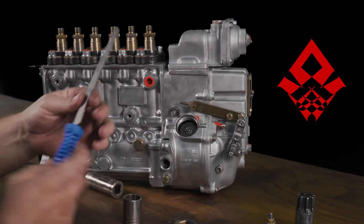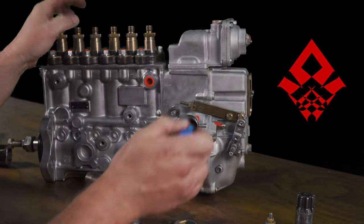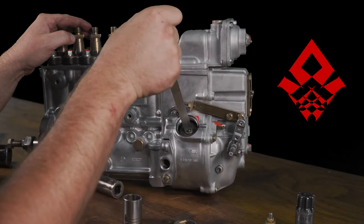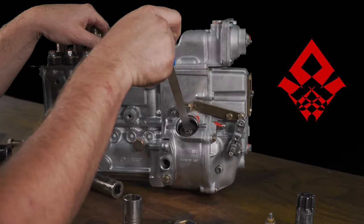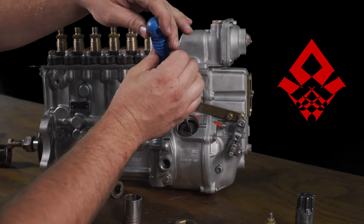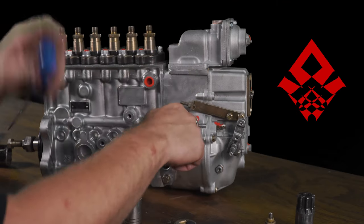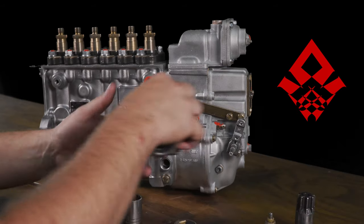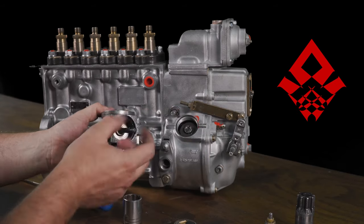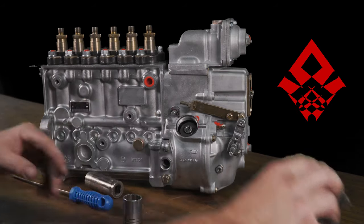Now the governor springs are lined up. Take your Power-Driven Diesel governor spring tool — it's just a little nut with two slots. Put it in there and back it off. I like to count the clicks when you're pulling it out; usually there are about four hard clicks — every 90 degrees is a click, and it's got four cam bumps on it. After about three clicks, it's loose. You don't want to drop anything in the governor housing — that's how this governor got damaged. Somebody dropped something in there, it bent the stud, and the truck would no longer govern. This could cause a runaway condition.